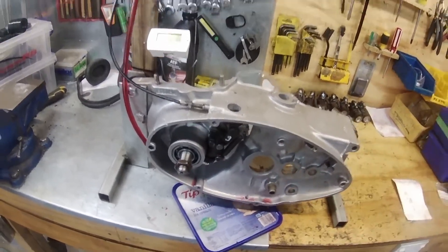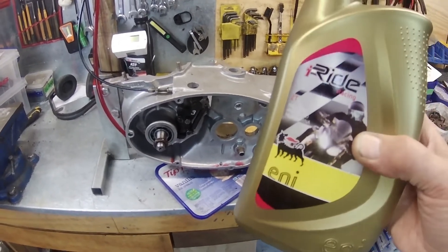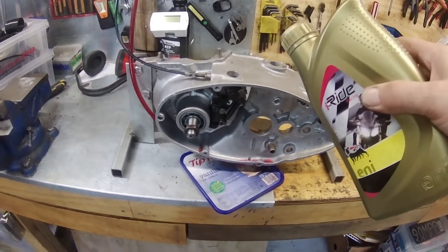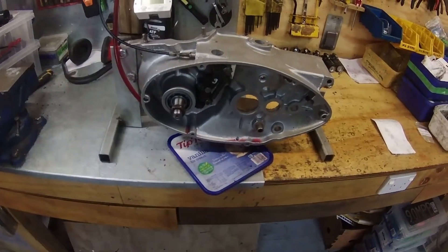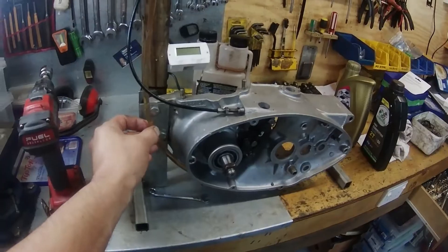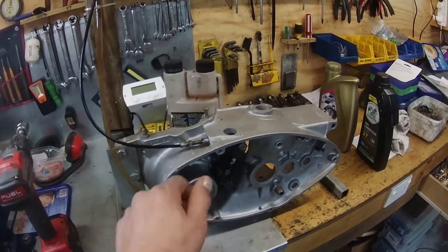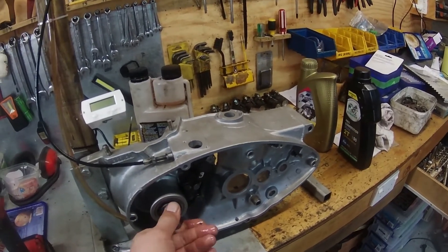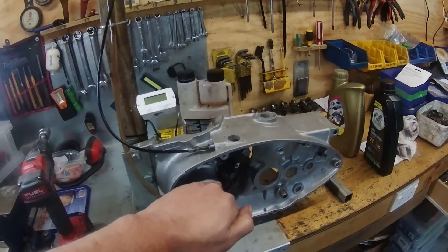The plan is now to repeat the whole thing again with just regular two-stroke oil. This is some synthetic two-stroke oil that I'm using for my scooters and mopeds. So we do the whole thing again with the oil pump in the zero throttle position and we'll see whether that gives similar results to the ATF. I just bled the oil line with the two-stroke oil. I'll put this on full throttle and turn the crankshaft over just to get rid of all the red ATF that might still be in the system.